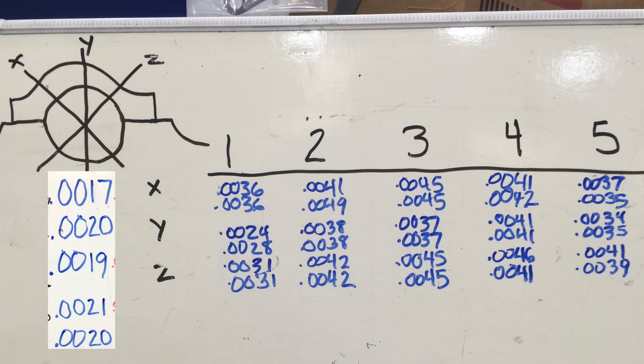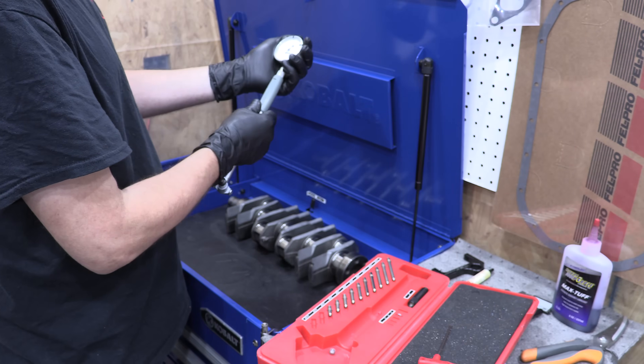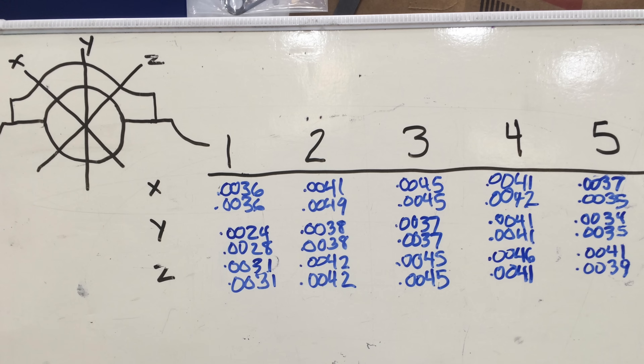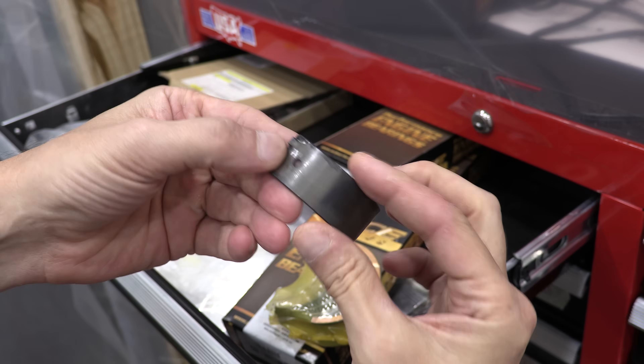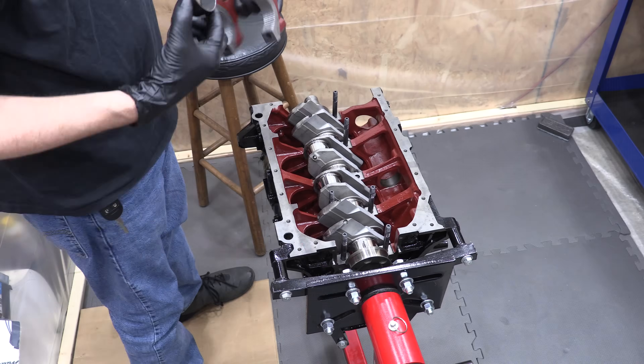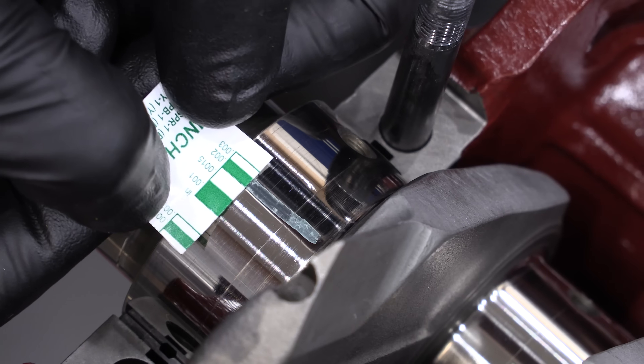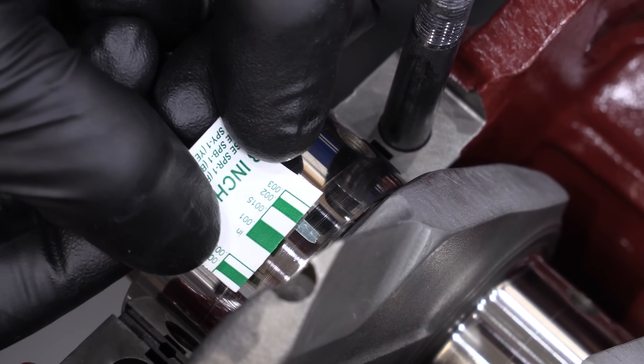Your machinist isn't going to use PlastiGage. The only truth you'll find in determining your actual oil clearances will come from using micrometers, dial bore gauges, and to a lesser degree, snap gauges. All PlastiGage does is measure the rough estimate of a clearance between the part and the hole, however it fits, and only in whatever random spot you place it. Mine came out straight because the crank is straight and the hole was honed straight-ish. Even though PlastiGage ranks with the accuracy of a visual inspection, it's the only visual inspection that can estimate measurements of how assembled parts actually fit together. If your bearings aren't seating right, or you get results that don't line up with what your actual measurements say it should be, well then you have a problem to find.